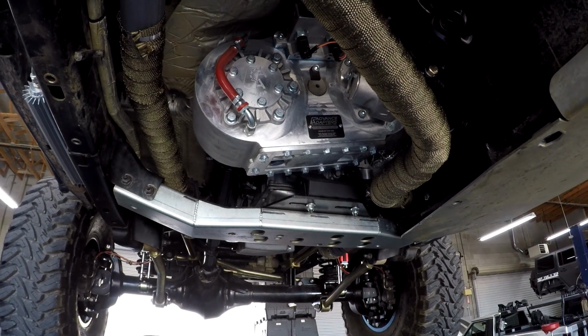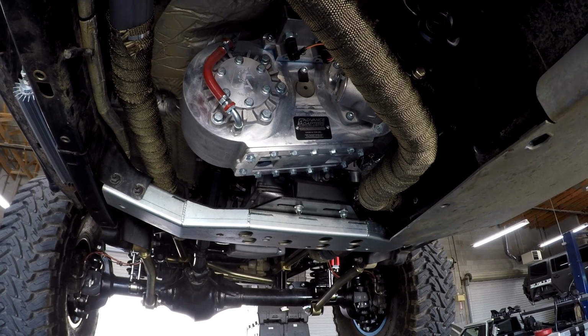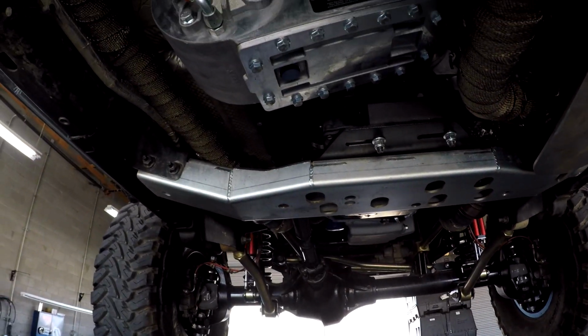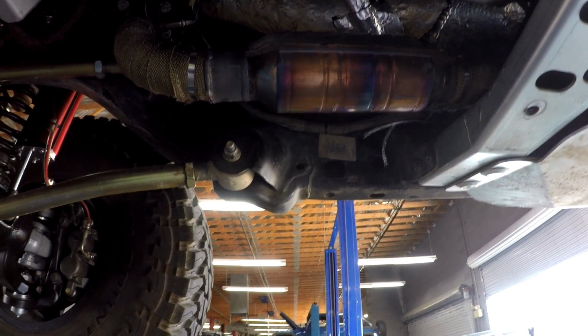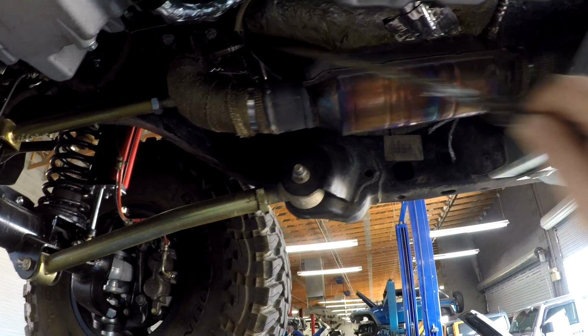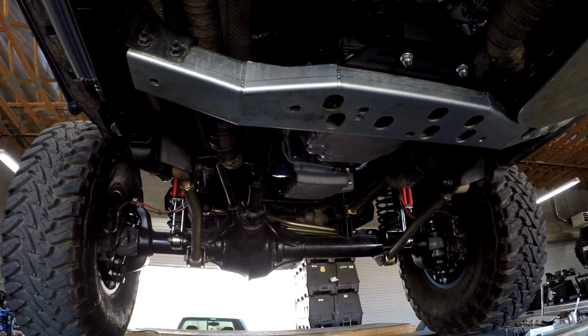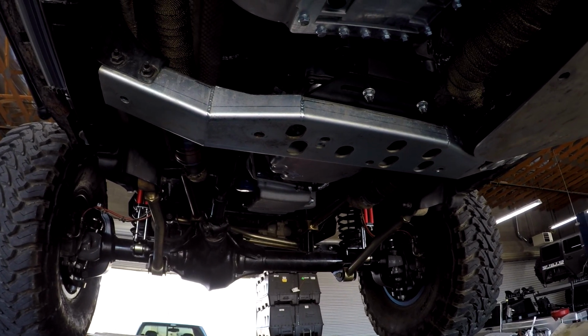And one of the things you need to keep in mind is that this Jeep isn't putting all the heat into the radiator or the engine compartment. We're putting heat out here, we're putting heat out in the back. We're offboarding as much of this heat as we can. These converters do have shields on them. These are full-size converters, and they can stand up to the LT4. You notice that we got heat tape on everything. And we take it serious here in Vegas because when we're pushing 115-degree temps in an engine that is 10-to-1 compression with over 9 pounds of boost, that is a lot of heat we got to get rid of.